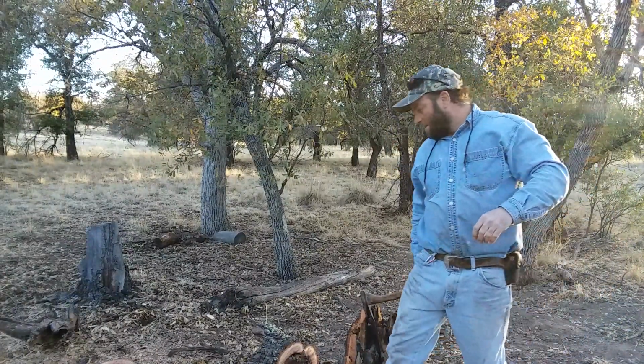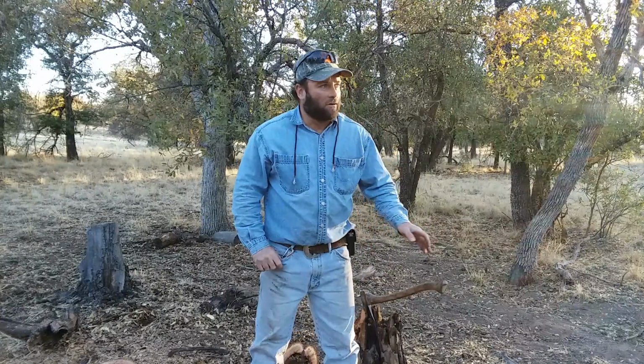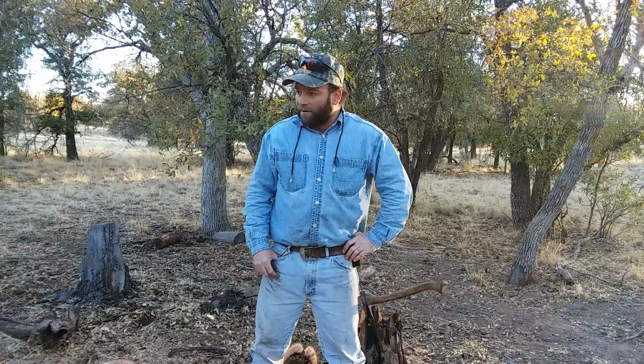Well, you can all see that Stihl with that chain on there hasn't been sharpened. That's just from the factory, the way I bought it. I did a few cuts with it, not a whole lot. You can see how it's cutting there, but that saw is acting goofy. So we're gonna have to put that on a bench and find out what's wrong with it. We're probably gonna do another pressure vacuum test on it to make sure intake boot or anything didn't go on that there. So Homelite's running so-so, but it should run better. It should not be goofy like that. So just wanted to update y'all with that.